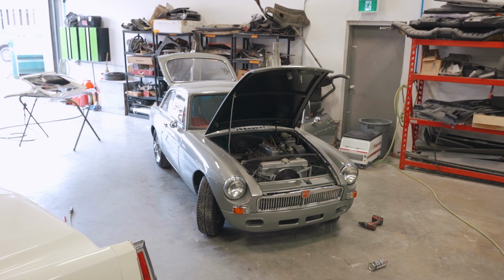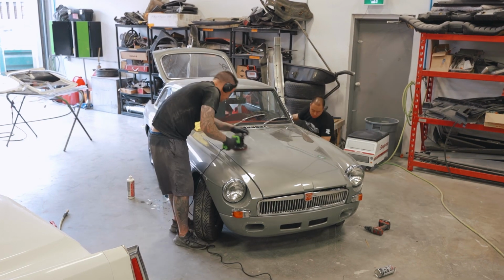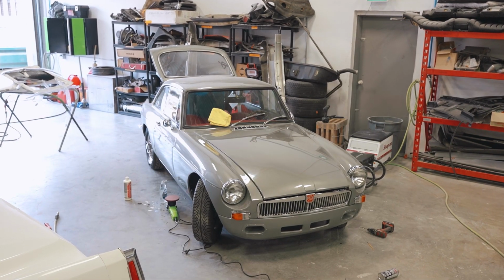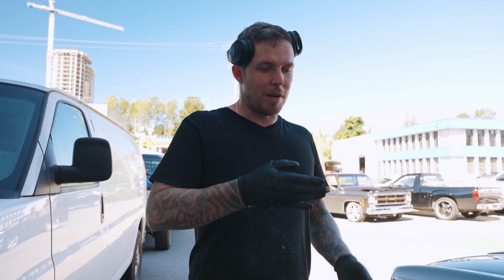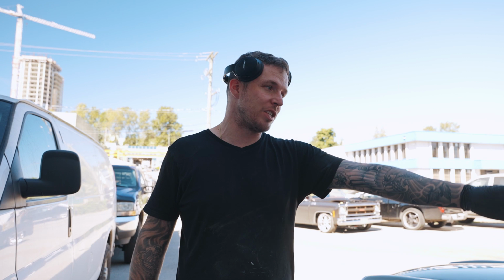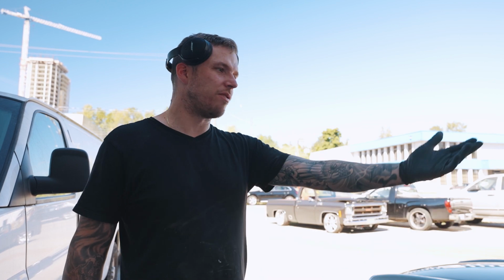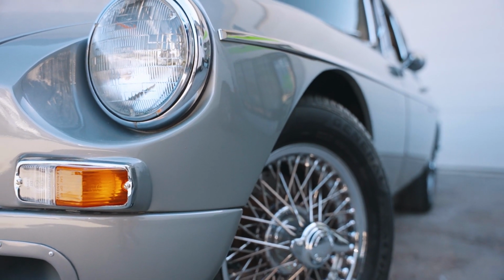Like I was saying, there were a lot of little issues in the paint, and that's something you have to consider. If it has a little imperfection every 3 to 4 inches, by the time you strip that little area everywhere on the car, it's better and faster almost to just strip it right down to bare metal. And look at what we exposed. We exposed a lot of things, like the quarter panel replacement that was done really poorly. If we would have painted over it, who knows how long that would have lasted down the road. Now that's a much better repair.